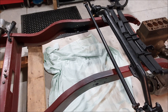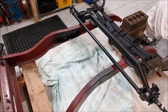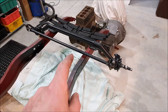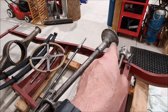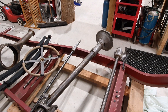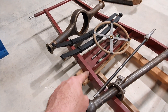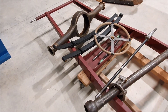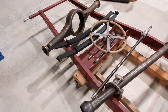I may even smear some copper grease in between them — I don't think it's ever going to rust out in between there but it won't hurt. Then the next thing will be putting the front axle and front springs back on and start looking at the rear. The other thing I can do now that I've got the torque tube is start looking at assembling the differential, crown wheel and pinion. But the most important thing is these rear pins because once I've done those I'm much closer to getting the car on its wheels — and I'll need the rear axle done as well of course.